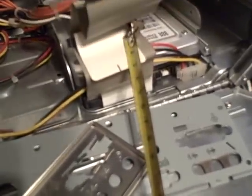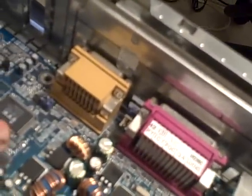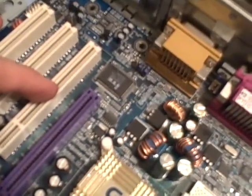I think that's it for now. I'm going to take this outside, get the Dremel tool, and cut out that back panel so we can get the standoffs where they need to be for the motherboard. Once I get that cut out, I can't really tell where the standoffs need to be right now because when you try to line everything up, you can't get it accurate enough — you can't get it recessed, it bumps up against it. So once we get that cut out, we can get it in there and find out exactly where the motherboard standoffs need to be.